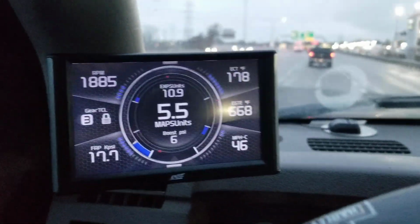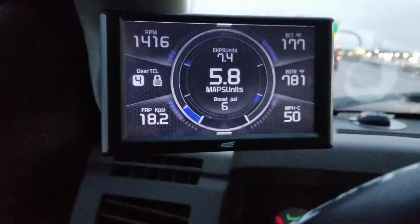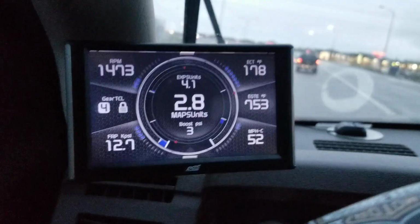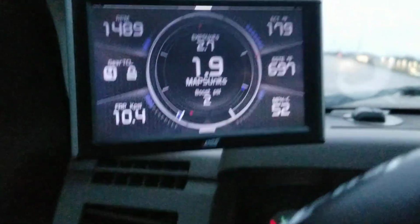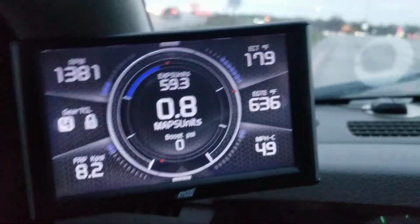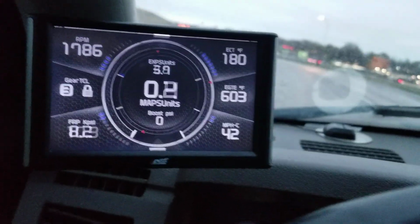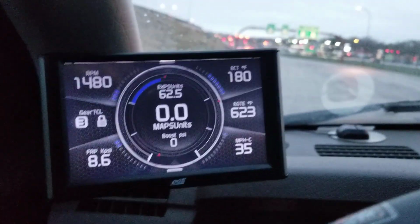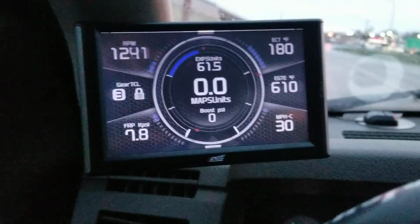So if you have a 2007, well, any of the 5.9 common rails, when the exhaust brake kicks on with an automatic, it will lock the converter for you, unlock it, downshift, and then relock it. So I'm in 4th gear and locked. Unlocked, downshift, and it relocks. Keep the brake on until you get to about 20 miles an hour.